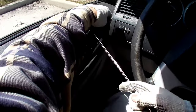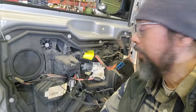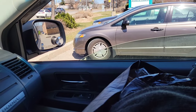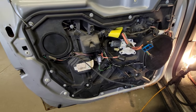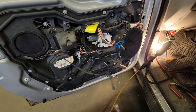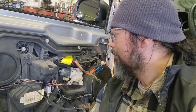If it's just a connection issue — this is all I've got. Look at that: a very similar unit for a 2008 Dodge Grand Caravan. There's the connection. So what we've got here is my window won't go back up. I keep trying to press it to go up and my window's not going up. One of the first things I needed to know was if it's the motor — the actual motor that brings the window down — or if it's just a connection issue. So I took it over to the garage and got it tested out. The window rolls down but it doesn't go back up. The motor's fine, the connections are fine — they've been tested. So I'm guessing I need a new switch. Most likely a new switch.